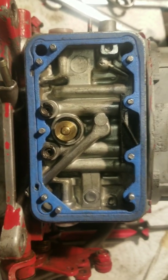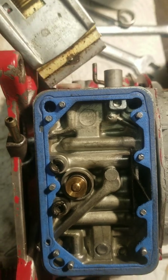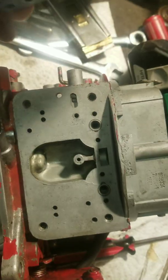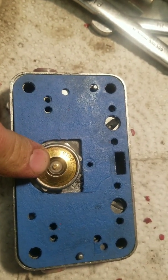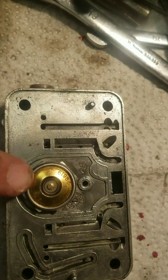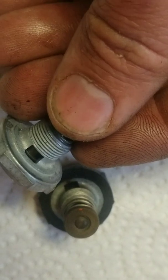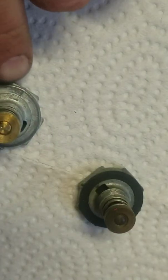On to the big piece of the carburetor — this is the most important. Take your time, remember where everything goes. Take a razor blade, run it around the edge all the way around. We're going to replace this as part of the rebuild. A crescent wrench is the easiest way to get them off. Remove the gasket here and just put a crescent wrench and loosen this up. Notice the gasket on the one I just removed — make sure you put a new gasket on. I did look in the directions: one of the ways you can tell is it's got a square on the side there. It does say 40 pounds to reinstall both of them.